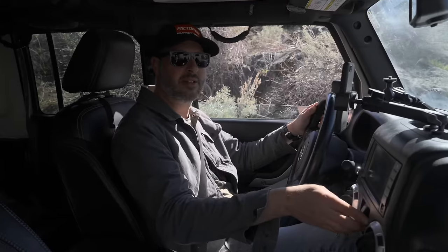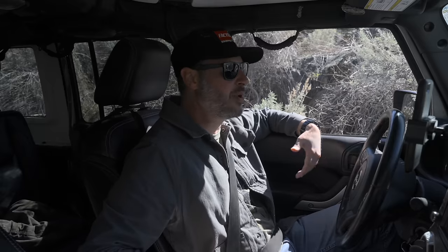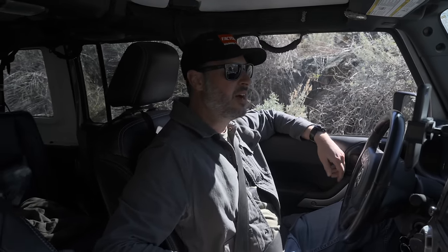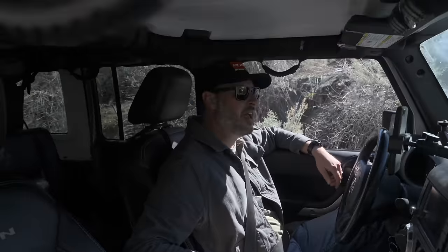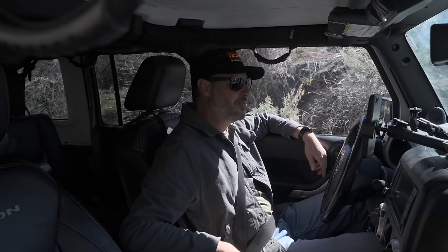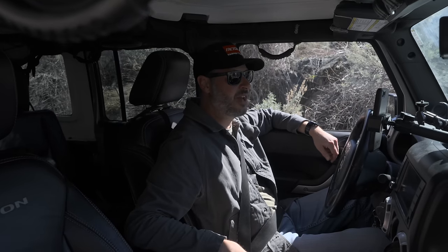Yeah, so Chris, we're hearing like binding or something underneath your suspension. Yeah, there's something that creates kind of a twanging noise, and it's been driving me kind of crazy the last week or so, because I get it every once in a while, like when I'm driving and turning, it'll just do this little twang. I've gone through and everything is tight. I've tried every single suspension bolt with all the weight on the ground and they're tight.